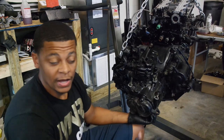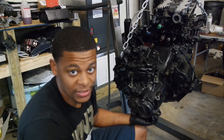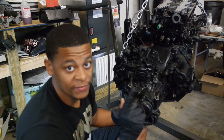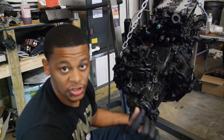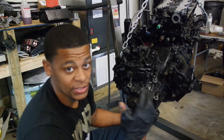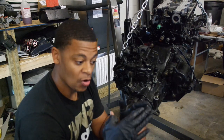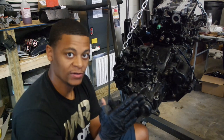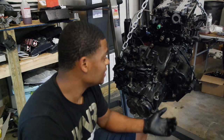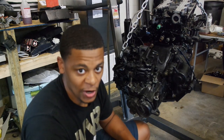I might have made that look easy. For those of you who have ever tried to put a transmission on by yourself, you know it typically never goes on that easy. One tip I can give you that would definitely help: when you take off the transmission, there are two little dowel pins on each side. Those dowel pins really make it hard to get the transmission back on, because you're already trying to rotate that last little bit to clamp it together. If the dowel pins aren't on the trans perfectly, you have about an inch and a half of space you have to fight. Personally, I take the dowel pins out — that way it's easier to get the transmission on and I can literally rotate it on the spline until it gets perfectly where I need it. That's a tip that can help you get it on a lot faster.